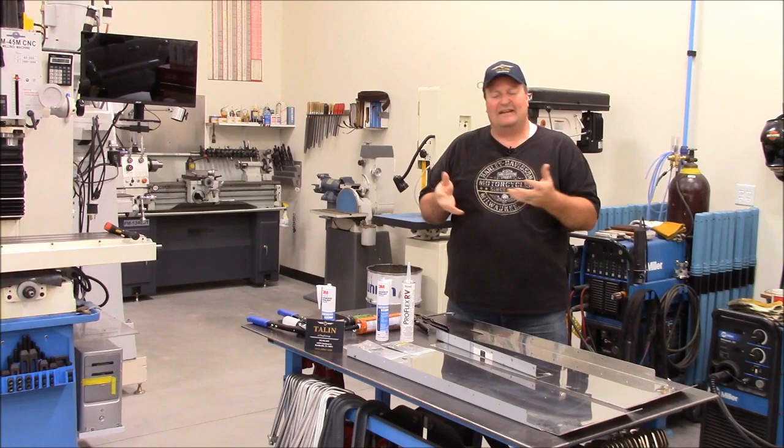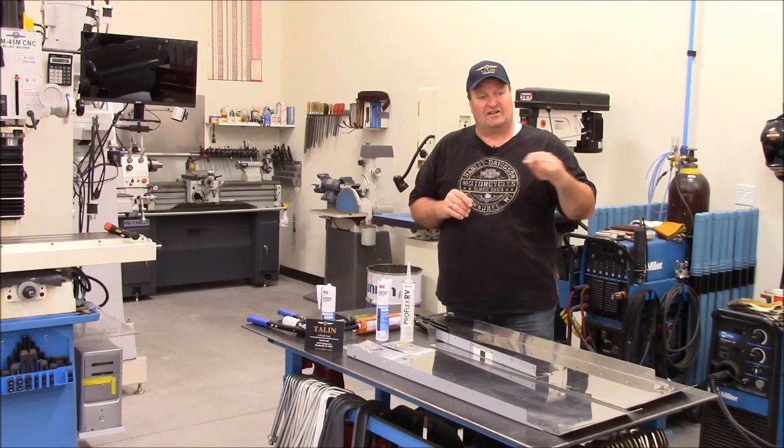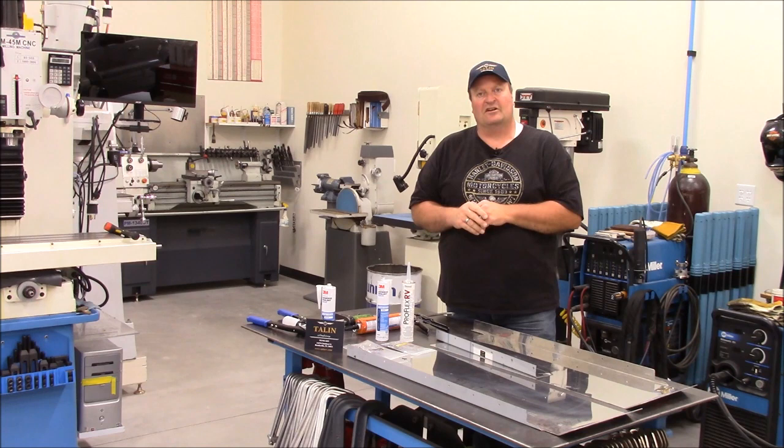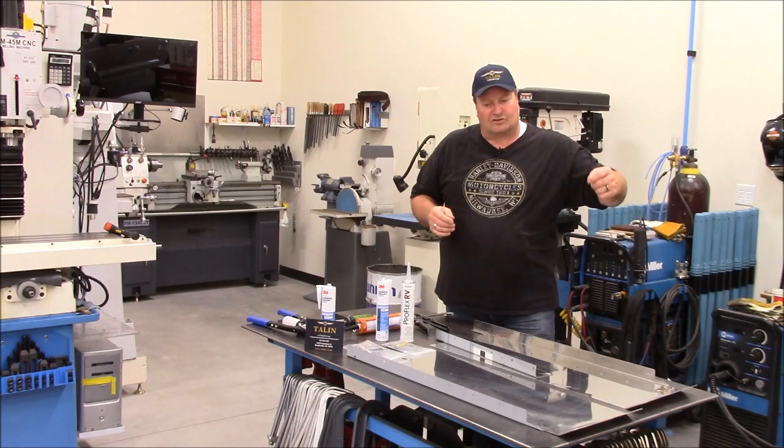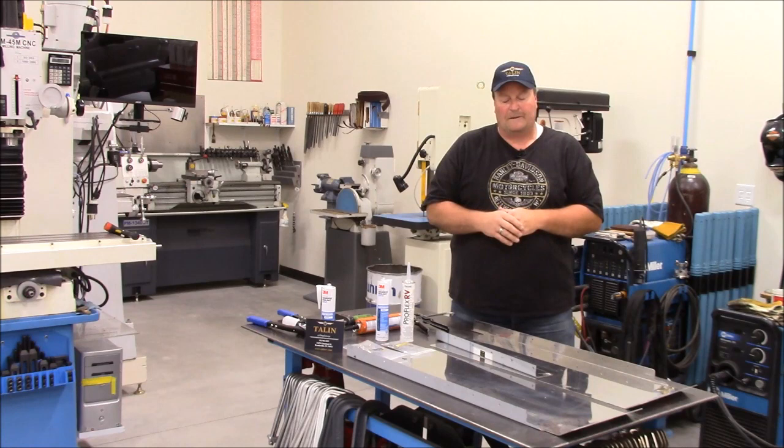And our coach, up until a year ago, was parked outside, so I was adamant and very vigilant on keeping that caulking fresh and sealed. I inspect it regularly. If there was any cracking, I probably was a little over the top, but I would scrape the caulking out, clean it with acetone, wipe it all down, tape it off, and reapply caulking to all three slides because I was so paranoid of water damage, water intrusion.